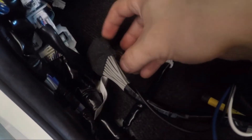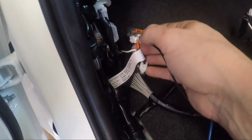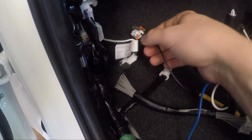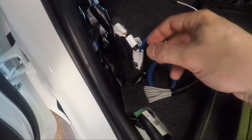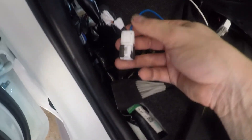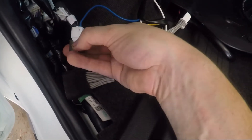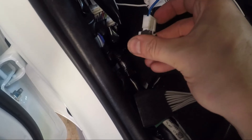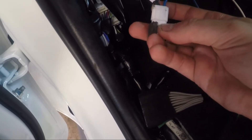For the four-prong connector there's a little orange tab that you need to pull up. You have to strip away some foam to expose it, slide the wire in, and then clip the tab back down — it's like a little lock. The other connector where you plug the blue wire in has a really tricky locking mechanism: you push the white bit up, insert the wire, then squeeze it back down. It took me a while to work that out.